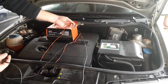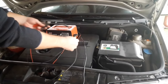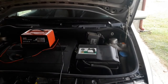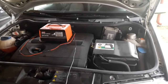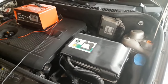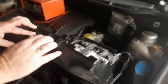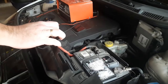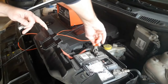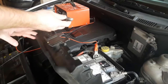Once you've properly positioned the charger, it's time to connect it. On the charger you'll usually find three cables — two with clamps and one for the power supply. The clamps usually have red and black markings so you can recognize plus and minus and which goes where on the battery. The main thing to be cautious about is not to mistake which clamp goes where. The same colors are on the battery: red for plus and black or blue for minus. If there aren't any colors, there will be icons engraved near the terminals. Red clamp from charger to plus terminal on the battery; black clamp on charger to minus terminal on the battery.